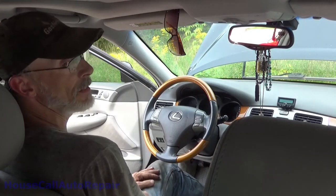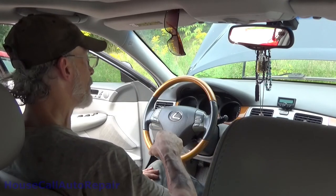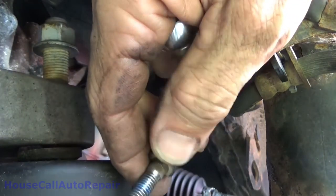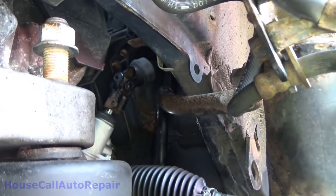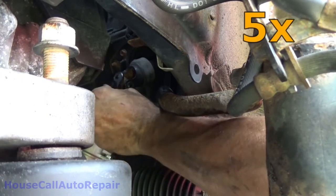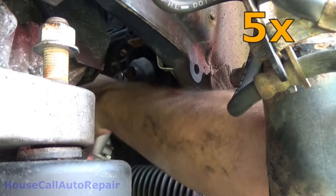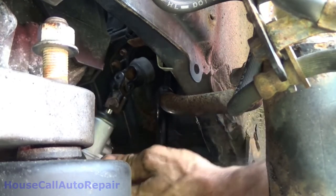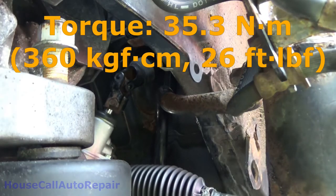Alright. So now we get to go tighten the bolt, put the pinch bolt in, tighten that up, and remove the tie rod ends off of the old rack and get them measured up and onto the new rack. A little bit of blue thread locker on there just to play it safe. Get up in here. Thread it all the way down in. Now with a little quarter inch drive wrench, that's about as tight as I can get it with one hand.